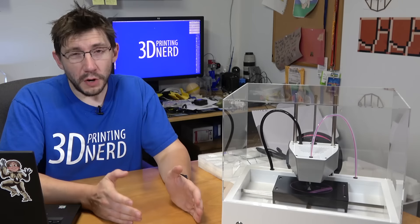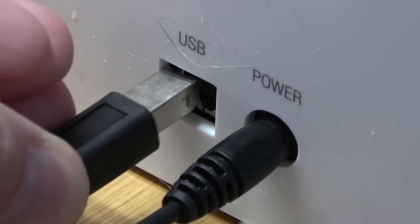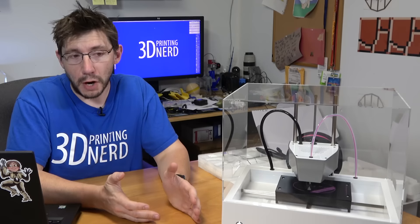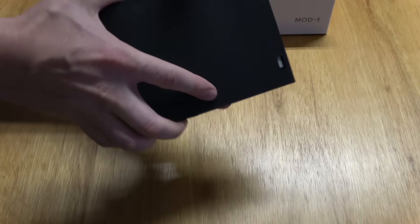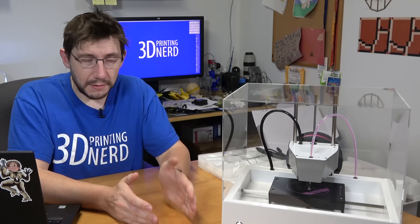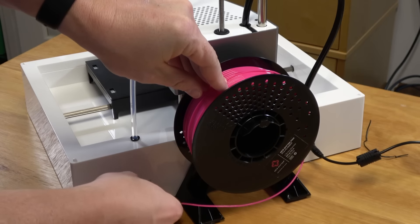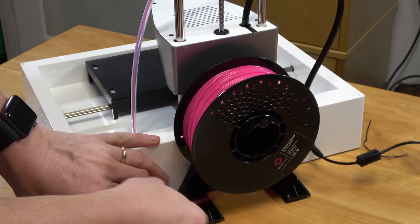She's in bed now because it's nighttime. The printer was fairly easy to set up. I had to take out the power cord and plug it in, take out the USB cord and plug it in, and download an application from the website. The application automatically talked to the printer, updated the firmware, and then connected the printer to my home WiFi. Once that was done it said I could unplug the USB. Filament loading was easy — there's a spool holder that goes on the back, and once you load the filament in the back, the filament comes in.